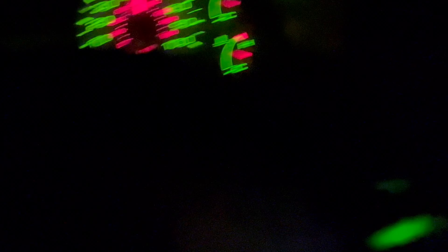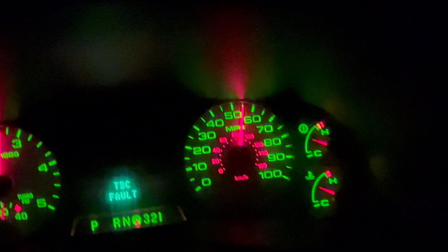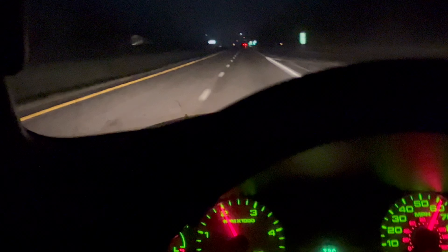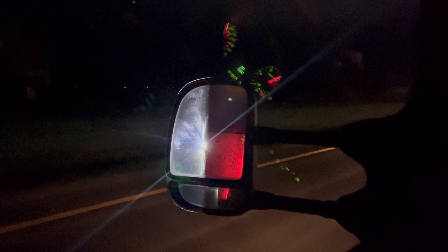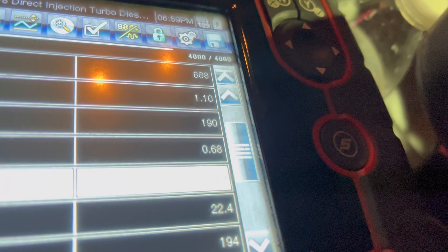We're back on the road at the top of the big hill. I caught myself slowing down talking to Julie and grabbed the gear — rode 208°F. I can hear the fan. We're already at the top of the hill so the fan is obviously doing something. It's a stock fan clutch so it won't really kick in until about 218°F. The truck is handling this double stacker very well — sitting at 199°F, just chilling. It's happy. 100 miles to the fuel stop and all is well. Shutting down at 192°F — that's great.